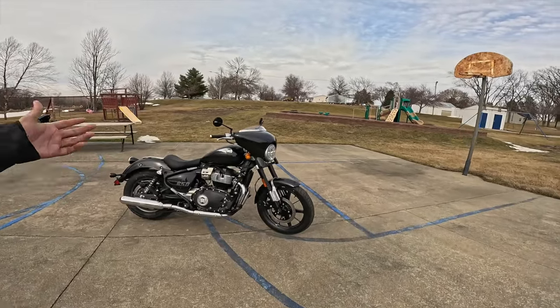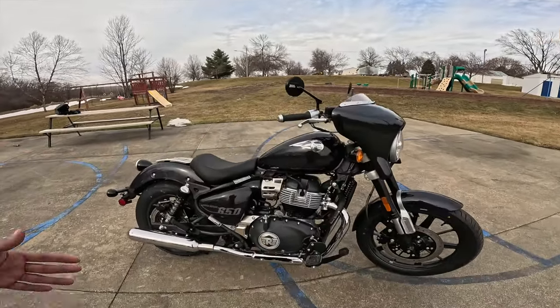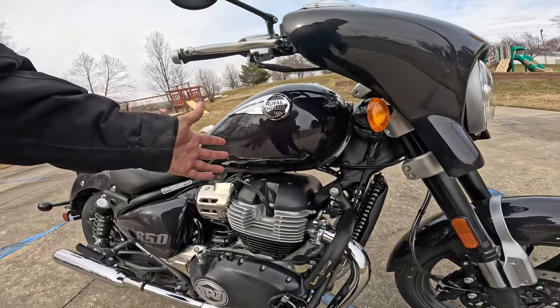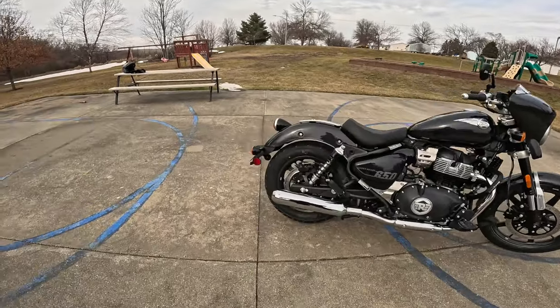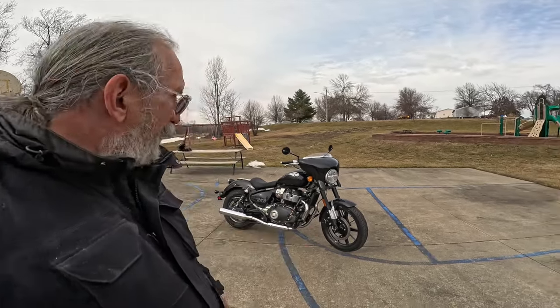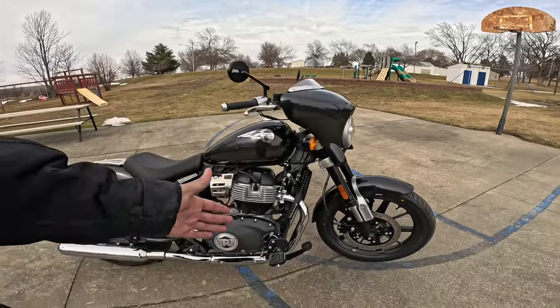Three things you should really know about a Royal Enfield. One: cost — about $7,500 in stock form; this one is $8,500 with all the goodies. It comes with a three-year unlimited mile warranty — one of the reasons I bought mine, since I intend to do six, seven, eight hundred mile days and my goal is 30,000 miles this year. Two: maintenance is easy — I did the valve adjustment and oil change myself. Pop the seat off, tank off, and all eight valves are right there. I did it in a couple of hours my first time. Everything is very accessible — the Indian market expects that kind of serviceability, so DIY is easy and shop costs should be lower.